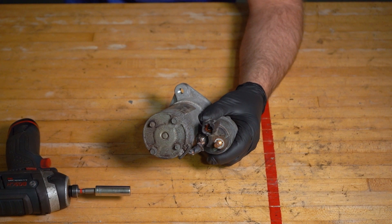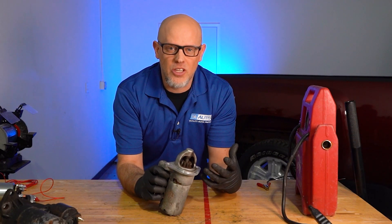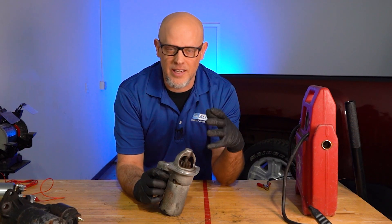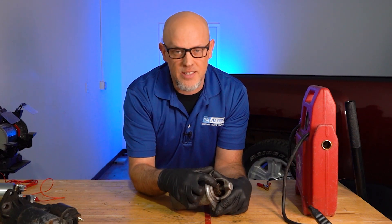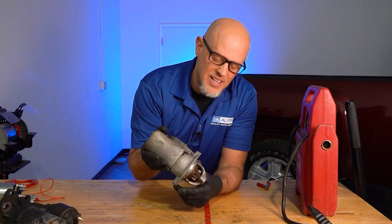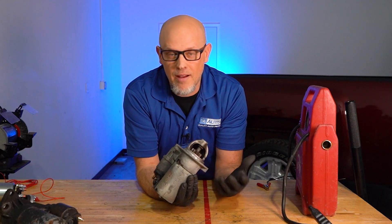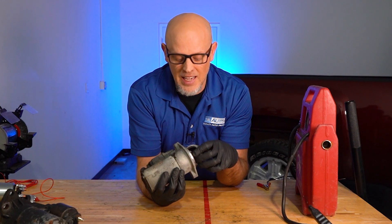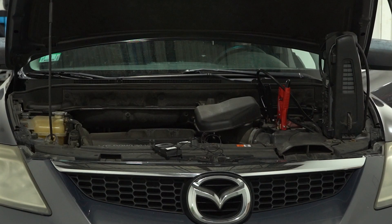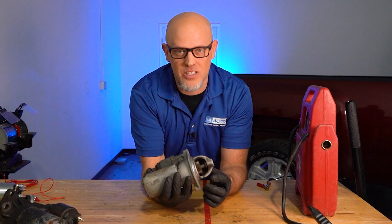This starter is a different situation. When we had the starter engaging, you actually heard almost like a grinding noise a little bit after the starter had started the vehicle. That's because this little gear right here actually stays out — there's nothing retracting the gear. So if you ever have a situation where the starter sounds like it's staying engaged, or you hear that tinny noise, most likely your situation is like this and the starter is just stuck.